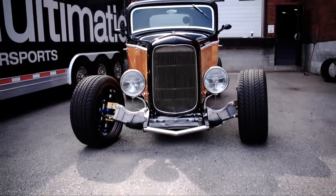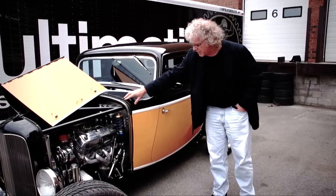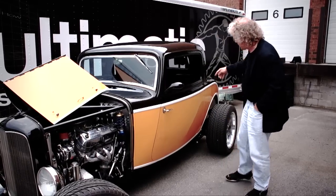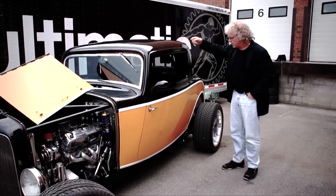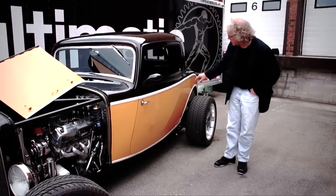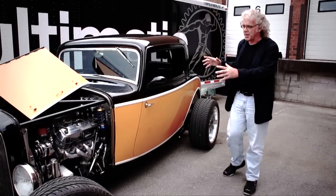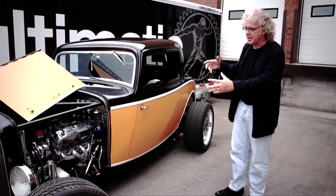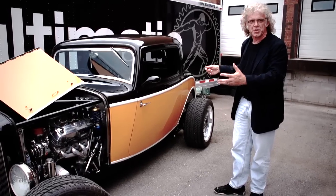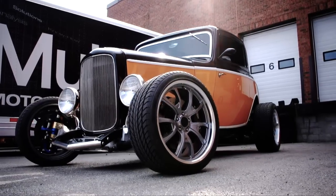And then off of that, we've built a tubular structure using this kind of tubing here, with hoops right here at the front of the cowl, right up here in the A pillar, up and around here, up around the B pillar, around the back, and then we've tied them in across the top here with cant rails and across the bottom. And then there's back stays that go all the way to the back of the car. So that by the time you're done, if I were to remove all this steel body, you would see a tubular space frame car, which is race car technology, the way a NASCAR is built, or an old Trans Am car. It has that level of structural integrity.